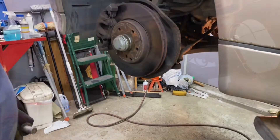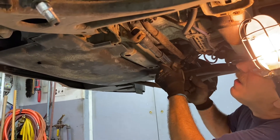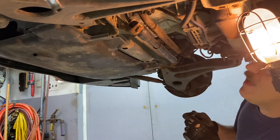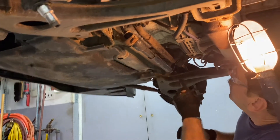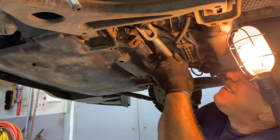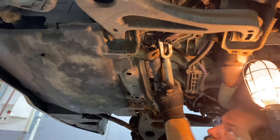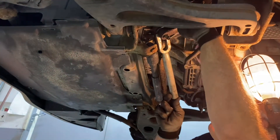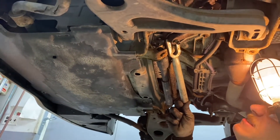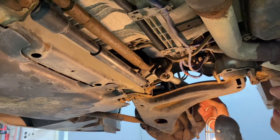The steering stabilizer just acts like a shock absorber to slow down your steering inputs. This one's good — you can check by seeing it has resistance pushing in or out — so we don't have to do anything with that. We got the other tie rod end already busted off, and now we have these two left to pop free. There's just a little bit of room to swing the hammer around here. We jolt the splitter in from this side, beat it in, and pop that one off.